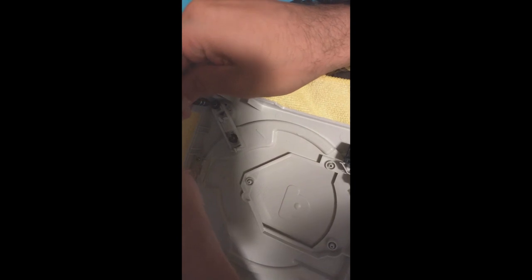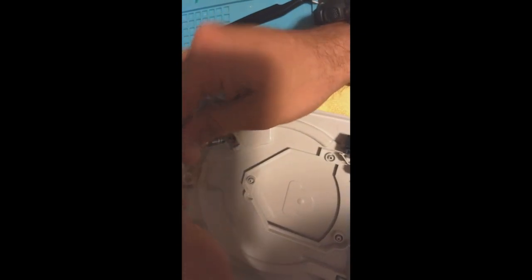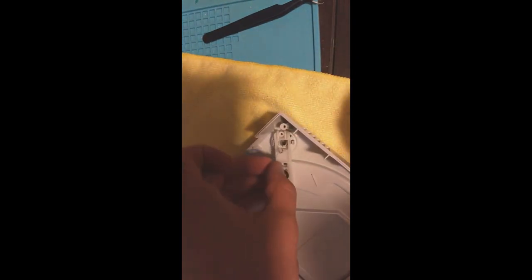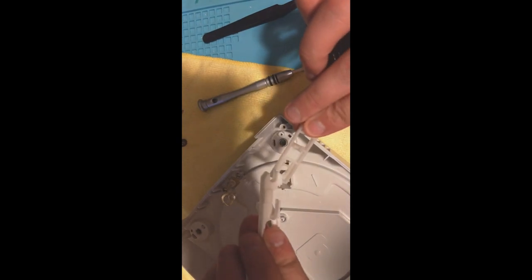This is the last thing I forgot to do, guys. Take these two screws out — there's two screws here. The reason we've got to take this out is because that fan is significantly higher than the stock fan. It pokes really high up out of the case, and to mitigate that, as part of this fan kit, there are two 3D printed pieces of plastic that come with it. When you do this, pull this back — the spring, it's a drive spring — and it should unhinge. This is the other screw. This is our drop piece of plastic, the 3D printed version. You see this is reinforced slightly more because it's cut.